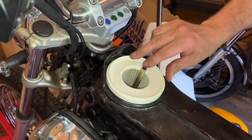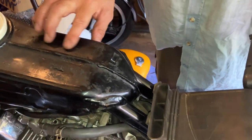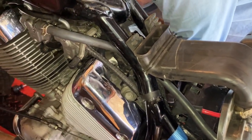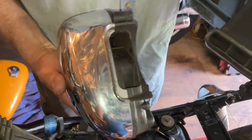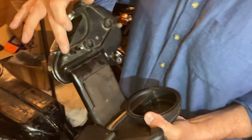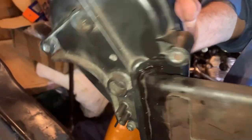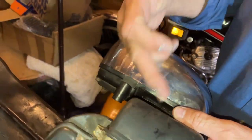Make sure that it's located on there. Because to do the carbs I took the air intake off as it was in the way of a screw, so I'm going to put it back on now. As you can see, it's got to go into this rubber groove, so we'll put a little bit of grease on that to make it easier to slide in. It was a bit of a job to get it all in because it's just gone stiff with time, but it's easier to do it together.